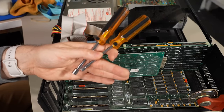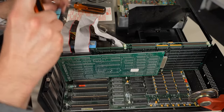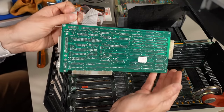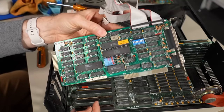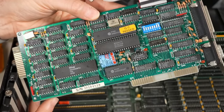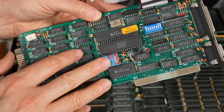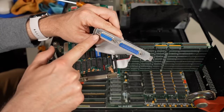Let's take some stuff out. These are my two nut drivers from my original tool set when I was a kid — basically designed for taking out the nuts on original IBM machines like this. The accelerator card has a battery on it, but it looks like the battery has not leaked. Are we not lucky? So we have a floppy drive controller, a real-time clock, serial and parallel ports — though it's missing some of the nuts — plus an additional serial port and a game port.